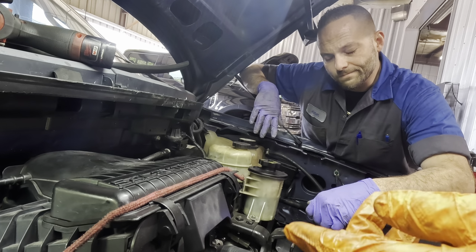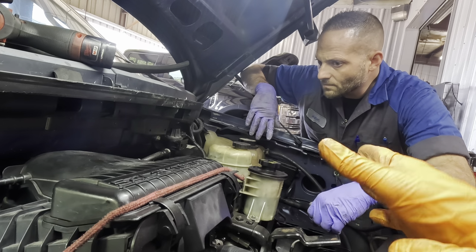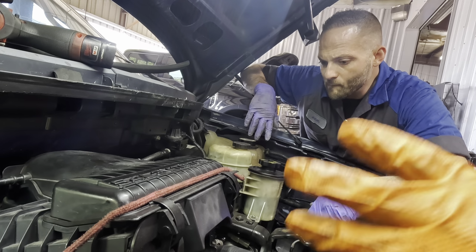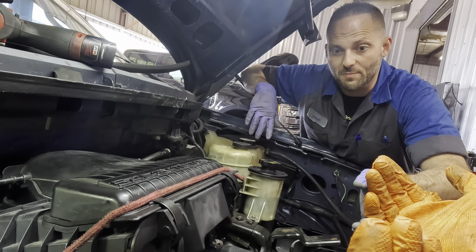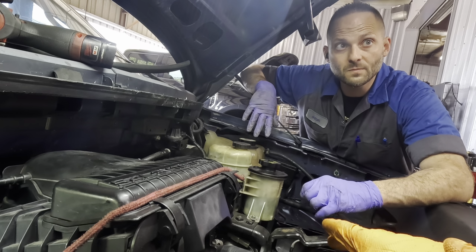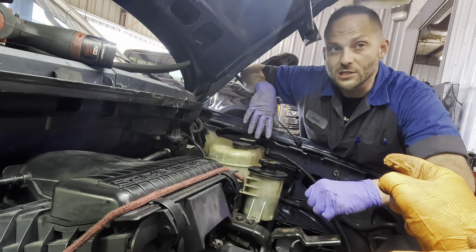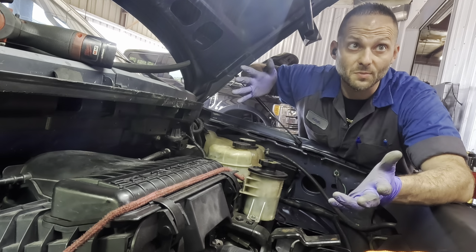It's a vacuum-operated system with manual lockers as a backup. So when you go inside the cab and say, put me in 4x4, it's pulling vacuum at the hubs to lock the front hubs, right? I can turn it on and immediately watch my vacuum gauge go to 12 inches. So the car is working, the button's working, and the vacuum pump's working. There's no leaks and it's holding vacuum, but they're physically not locking in at the hubs. Both sides? But if one side's losing vacuum, you've got a leak.